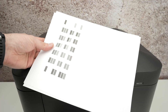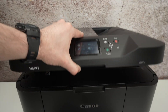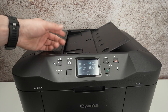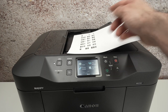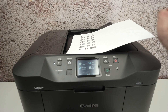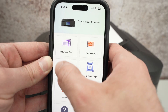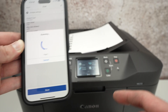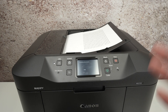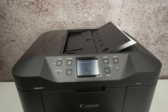If you want to use the automatic document feeder, let me show you. Say you have a document with 20 or 25 pages and don't want to place them one by one on the scanner glass. Align them, open the top document feeder, adjust the plastic guides, and place your document facing up with the top of the page towards the left side. You'll hear a beep confirming it has been recognized. Then go to the scan app and press Scan — the printer will take each page one by one automatically, saving you a lot of time.